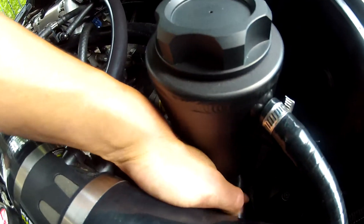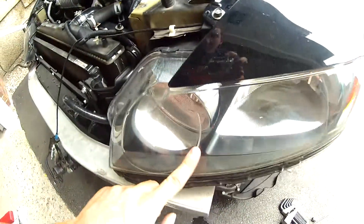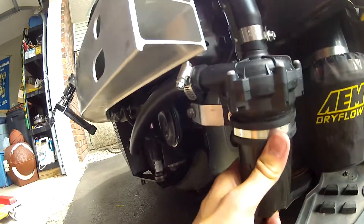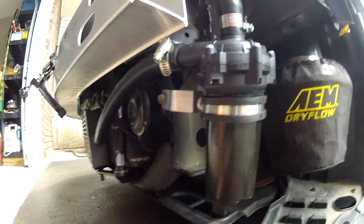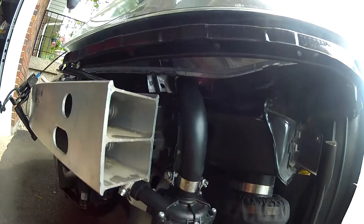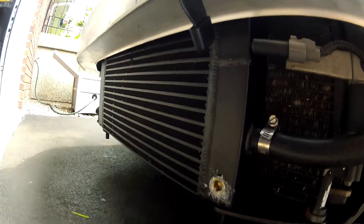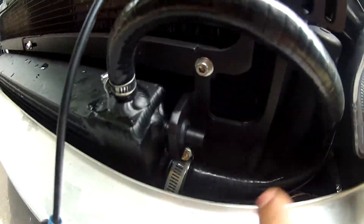On the bottom of the surge tank, there's the medium sized hose that runs underneath the intake, underneath this front headlight, right underneath here to the water pump, which I still need to hook up for the electronics as I mentioned earlier. Out of the water pump, the coolant flows this way obviously because it draws from the bottom of the surge tank. It comes out through here and fills the bottom of the front mount and comes out the top, which is right here.